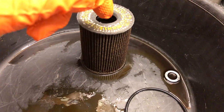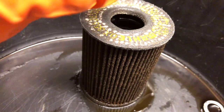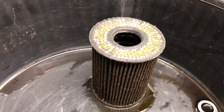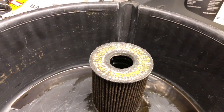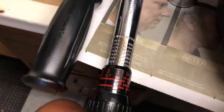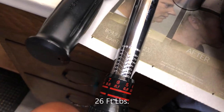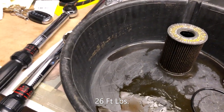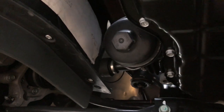You're going to get resistance until the new filter material gets pressed up into that area and seals again. Don't over-torque it — it's plastic. You're basically going snug until the two surfaces match up. As a reference, 35 Newton meters is roughly just over 20 foot-pounds, so we're not talking much torque at all — just enough to seal the cap so it stays in place. The oil filter cap is back on and torqued to 35 Newton meters.